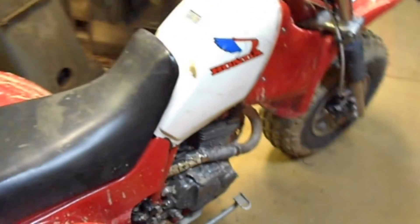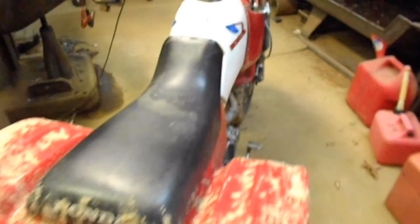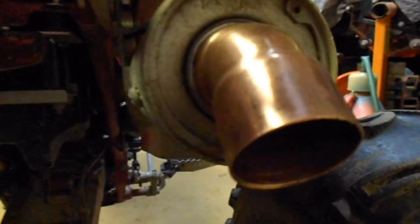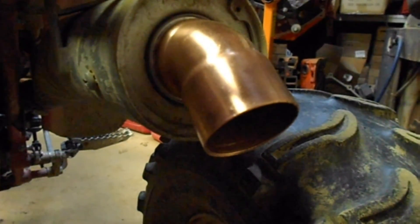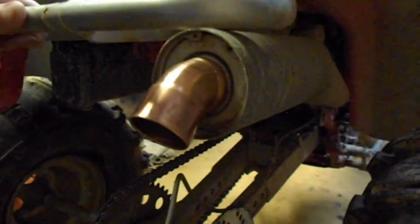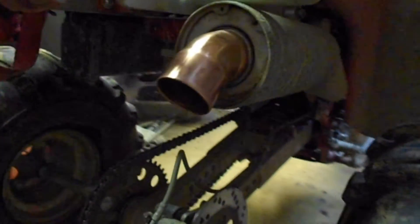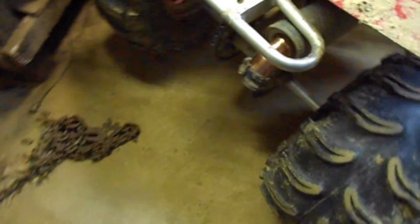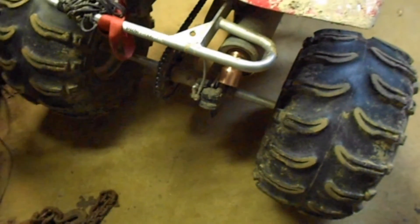This video is about the 45-degree exhaust tip I just installed. If you look close, way back in there, I had to make an aluminum spacer on the lathe — it's really thin. I didn't know if it was going to work but I got it to work. This copper piece is just something from the hardware store that almost fit, and the reason I put that on is because it was a little bit too loud for around here, especially deer season.